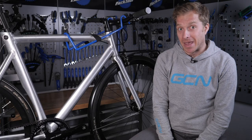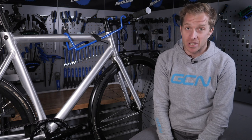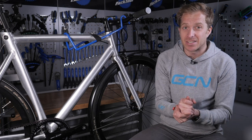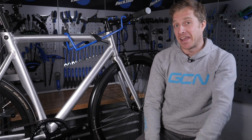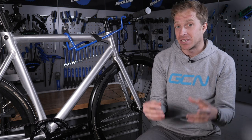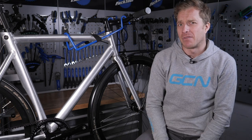Make sure that the tyres are not tread bare — some tyres actually have a handy wear indicator to help with this. Also, check that the tyres are round and not flat at the top, because some tyres can effectively go square at the top, which gives you really poor handling. What about punctures? Decent tyres designed for urban use will certainly help, as will puncture proof liners that go inside of the tyre and fit between the tyre and the inner tube.